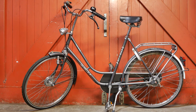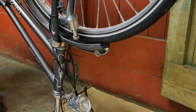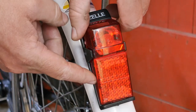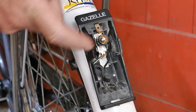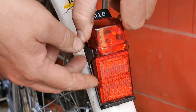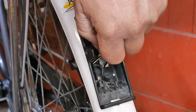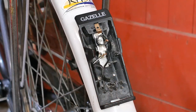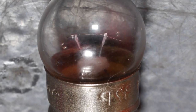I already checked the front light so I know the dynamo is good. Next I want to have a look in here and see if the light bulb is still okay. This tab on the other side is missing, but one tab seems to be doing the trick. It's hard to turn. Now I'll hold this against the light to see if the thin wire is still in there — and I believe it is. So we're good here.